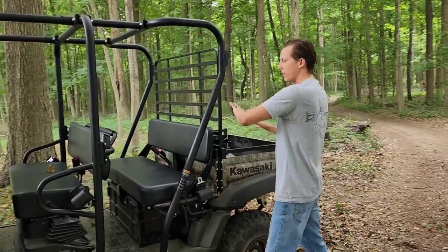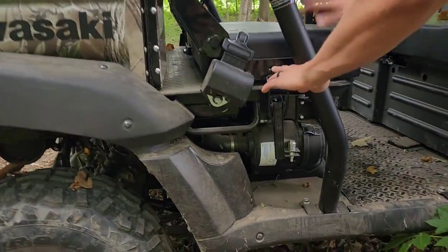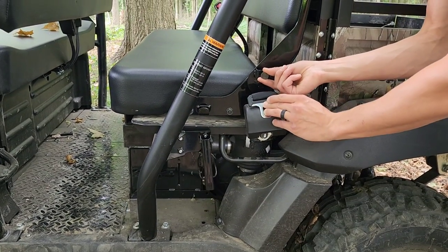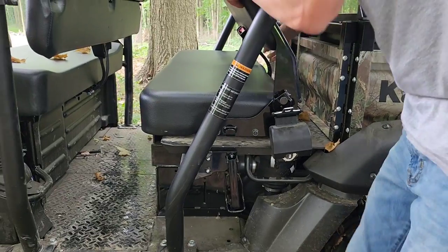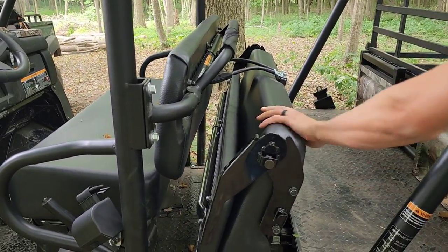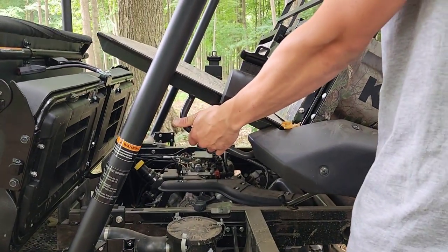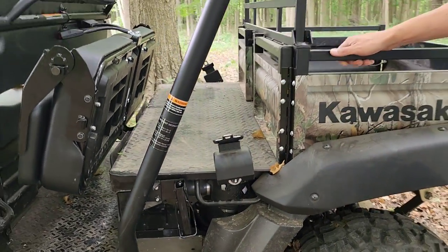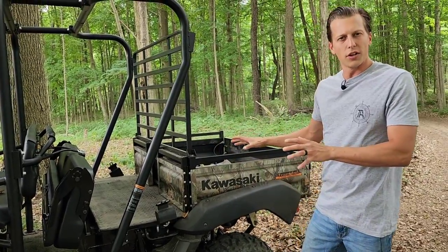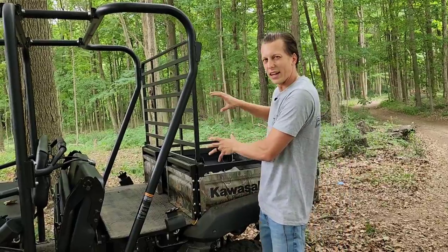Now let's go over how to switch this from the four seater with a small bed to the two seater with a longer bed. First you're going to lift up these levers on the sides that are keeping your seat down on the bed — there are two of them. Then pull this tab here which is going to drop your back seat. Move the seat belts out of the way and that's going to lock into place. Then flip the seat up using tension. This is also how you're going to use your dump bed feature — put it in this configuration and then lift the bed to dump whatever's in the back. It's a manual not automatic, so it's a little heavier, and even more so when you move the headache rack forward.